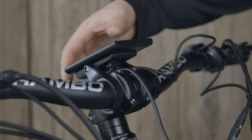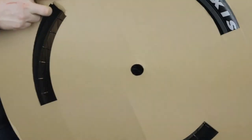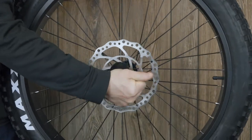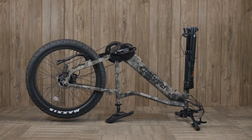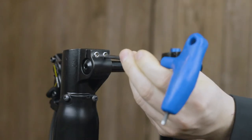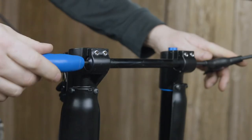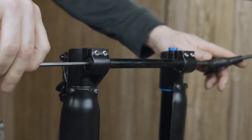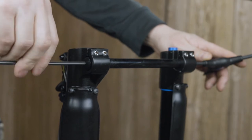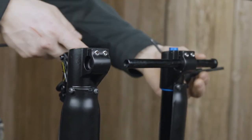If you don't have a bike stand, swivel the LCD display down and remove the cardboard and two plastic end caps off the front wheel. Then flip the bike upside down and remove the plastic piece inside the brake caliper. Loosen all four fork pinch bolts with a 4 millimeter Allen wrench. Then loosen the axle bolts using two 5 millimeter Allen wrenches and slide the front axle almost all the way out of the front fork to make room for the front wheel.